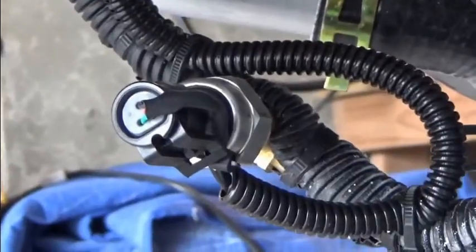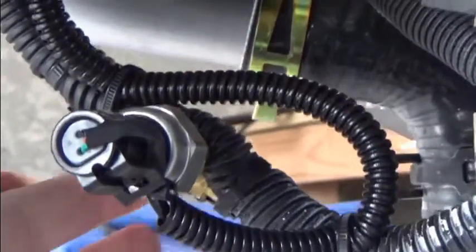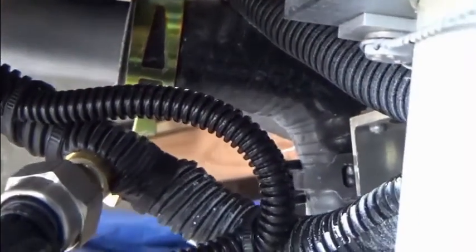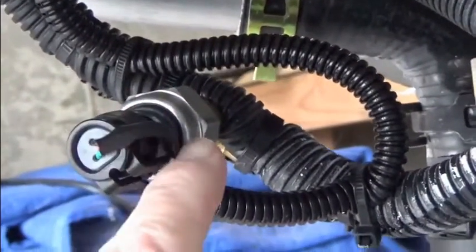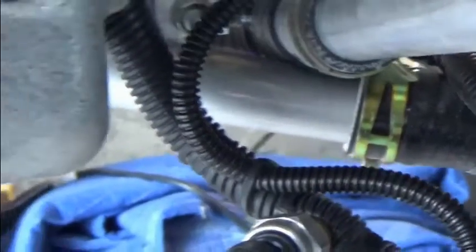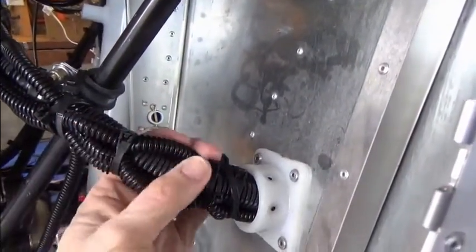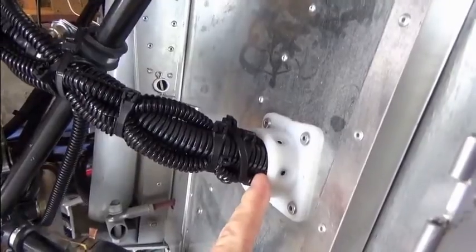Here is where I've spliced my fuel line — there's the sender spliced into the fuel line, and here's where I've stress-relieved the leads from the sender, taking off into a quarter-inch wire loom. All my wires run through the firewall at this point, with all four sender wires in one plastic loom going through the firewall and making their way back to the control box.